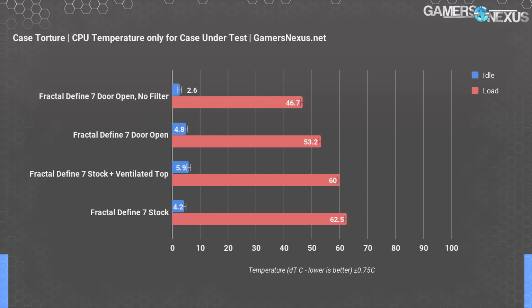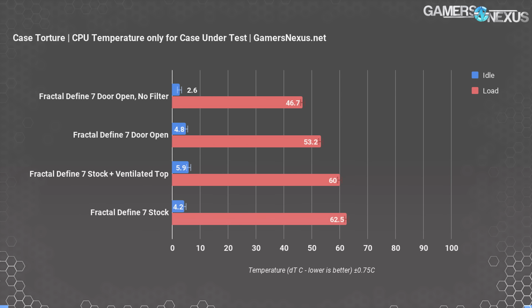Assuming you maintain the stock configuration of the case otherwise, having an air cooler with access to holes in the top without even adding fans or changing the pressure situation at all, it's probably going to pull in air directly through the top into the cooler. Going too hard on positive pressure at the front would turn the top into a more likely exhaust, so you might lose some air out the top from the front intake fan before it ever gets to the CPU.